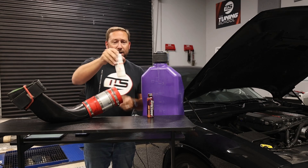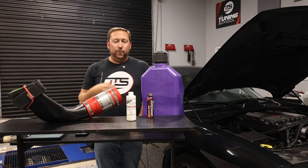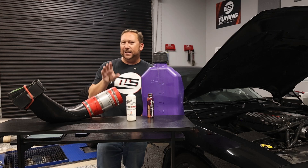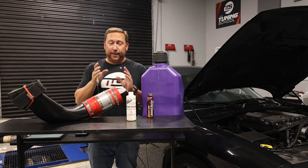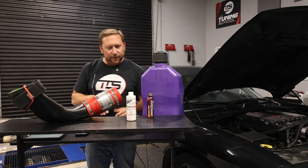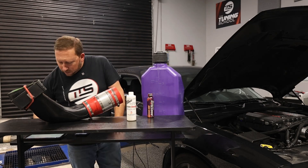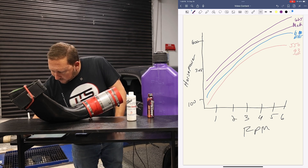But this is the good stuff — and this stuff goes into your methanol and mixes with it. What it does is technically nitromethane. I've seen stories from the 1960s where dragsters were exploding because they were running straight nitromethane, and that's true. However, if you use this in the quantities they direct — in this case, eight ounces per one and three-quarters quart — this will add another 30 to 50 horsepower.